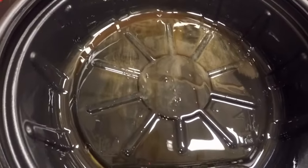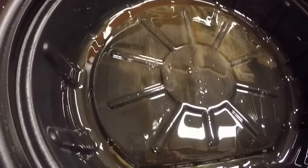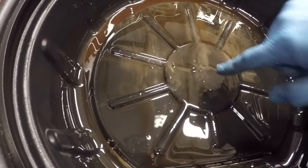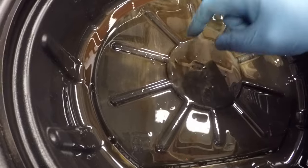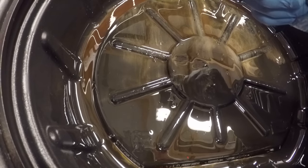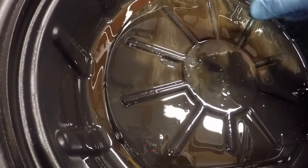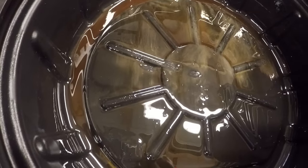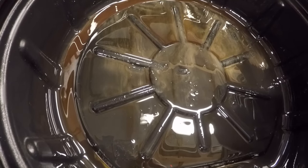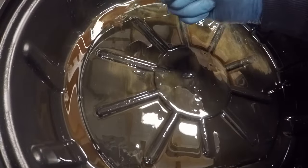Okay, oil was left to sit for a little while, just to see if it's separated out a bit. Always a good thing to do is check through what's left after you drain the oil away into whatever container you can use to dispose of. So I've got some little bits of black debris. That's hard. There's a little bit of emulsification. Smells very petrol-y as well, so that would probably support the position on the fact that it's got low compression on the horizontal cylinder, so it's probably allowing fuel to flush by.